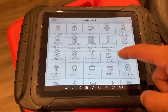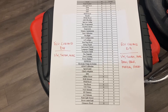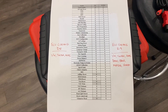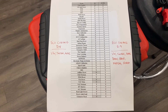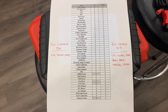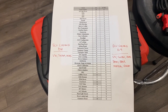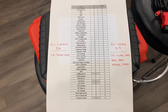You've got various special functions, but again they don't work on all vehicles. Comparing the D8 versus the D9 Pro: the D8 does not do AdBlue reset, NOx sensor reset, VIN writing, and lastly, it doesn't do odometer read — meaning if you're looking for the genuine odometer value, the D9 Pro will actually pull the odometer value from the ECU so you know exactly what that reading is, even if someone has done a correction on the vehicle.